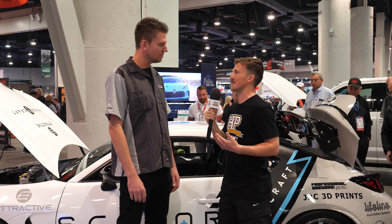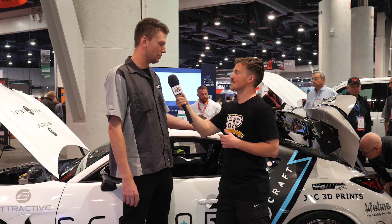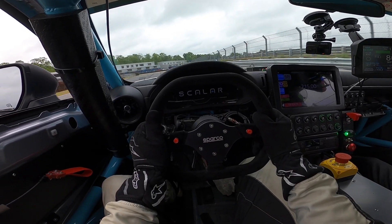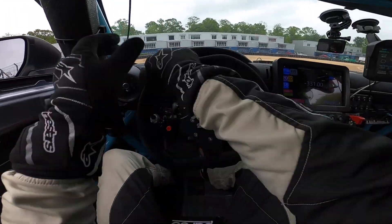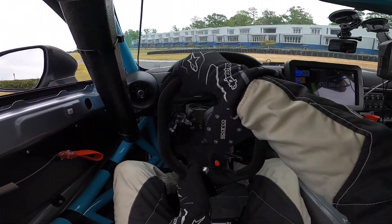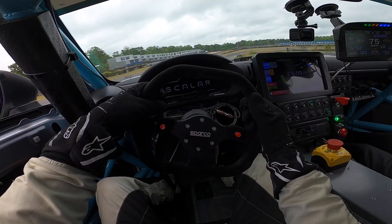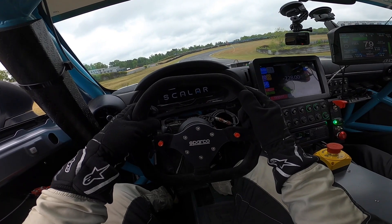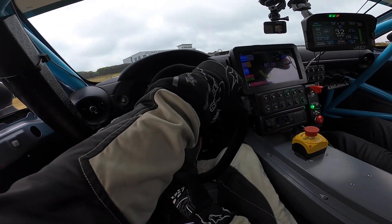That is going to be significantly cheaper, though there is still a cost associated with that. With maintenance on the rest of the car — your tires, your brake pads, things like that. Standard stuff. Also with the regen and the motor, you'll probably go through less rear brakes because the regen will do a lot of the braking for you in the back. Regen can actually be tuned so that it locks up the rear wheels if you tune it. That will be a big calculation in our brake bias as well, in terms of how much the regen acts in upsetting the car.